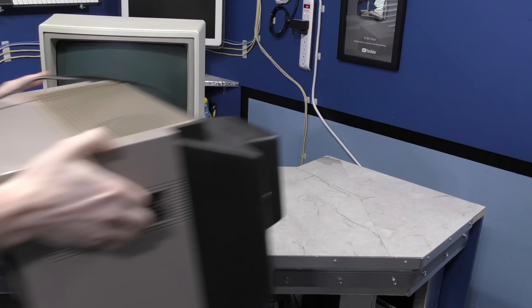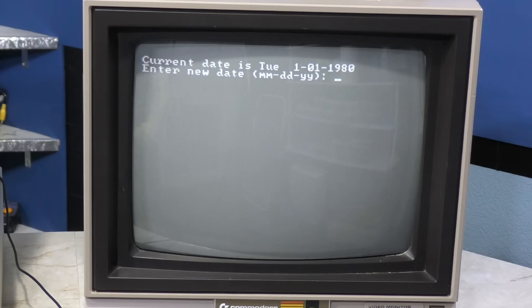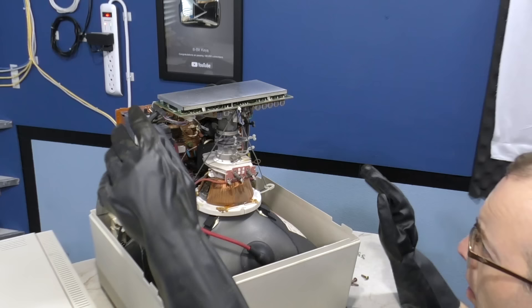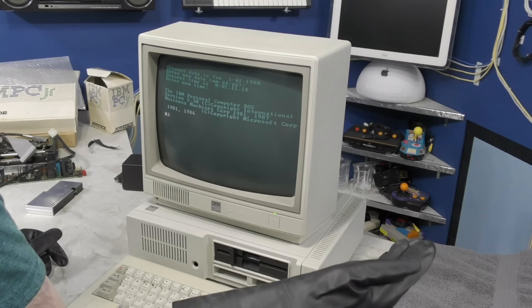Unfortunately, even though the computer appeared to be booting up, the monitor was just black. I tried the brightness and contrast knobs to no avail. Since the PC Junior also has a composite video output, I thought I could use that to at least test if the computer was producing a video signal — and it definitely does appear to be working. I'm thinking maybe something came loose with the monitor during shipping, as I just contacted Sean and he said it was working before he shipped it. I'm kind of paranoid with CRTs so I'm wearing my high voltage gloves. I couldn't find anything loose, but eventually I just slapped the side of the monitor and the darn thing came on. I already featured this in my most recent video on the IBM PC Junior, so if you haven't seen it yet, go check out the repair.